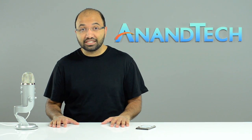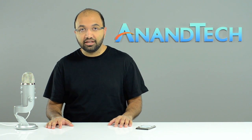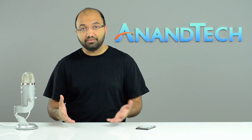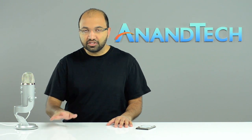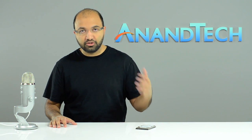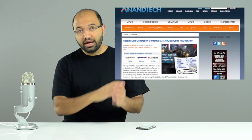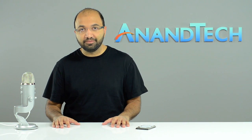That's the Momentus XT. I'm hoping for a more aggressive rollout schedule for future drives. Seagate's already announced that the Barracuda XT will become a solid-state hybrid drive as well, bringing that technology to 3.5-inch drives. I'd like to see a world where all hard drives have some NAND and do some of this caching, because it really does improve the baseline performance for everyone. If you want the full review including all the performance numbers, check it out at AnandTech.com.